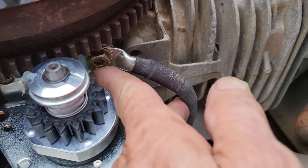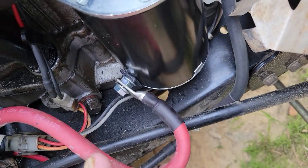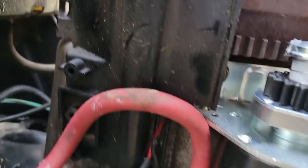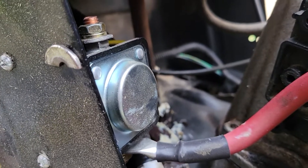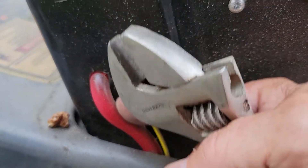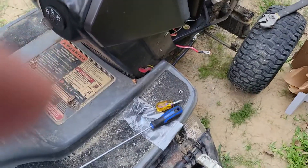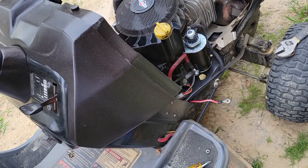I'm using 2-gauge wire. It goes all the way back to the battery — from the starter bracket down to the frame, then directly to the battery. On the positive side I'm also using 2-gauge wire to the solenoid — that's a Ford solenoid, not a Craftsman — and it goes straight back to the battery with the same 2-gauge wire. So every bit of current available from the battery should show up right at the starter. Let's do the test before I button it all up.